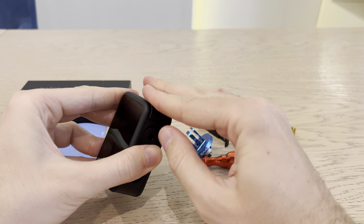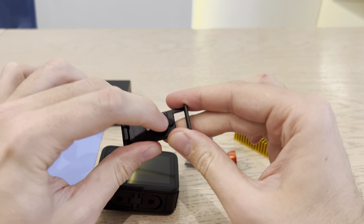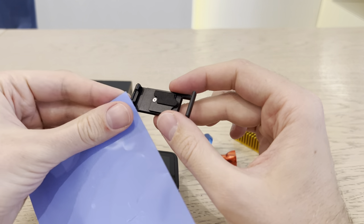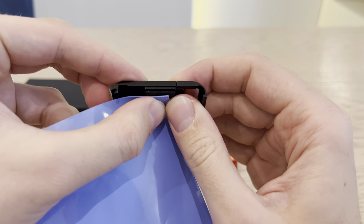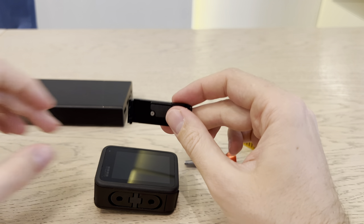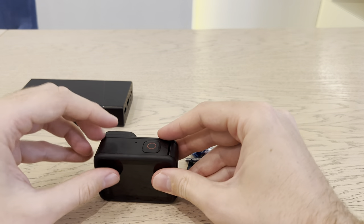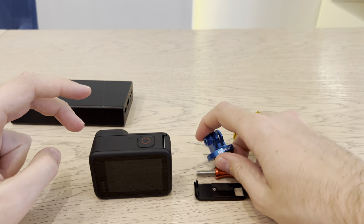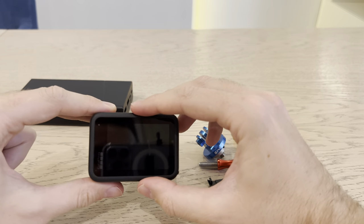You can go even further by removing the black foam piece and replacing it with a thermal pad like that. Probably two layers of thermal material will work in this case to be able to get more heat from the camera. So right now we have two ways to solve the problem: one is a metal mount and metal door, and another is a metal cage.